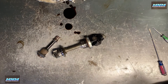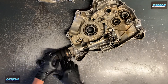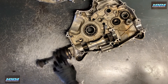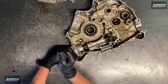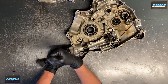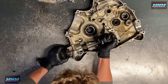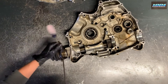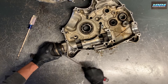We have what looks like a similar situation here on the front. We've got our boot and all this joint assembly here. I'm going to try to remove the boot right up against the motor here. You can use a flat or Phillips screwdriver or an 8 millimeter socket to remove or loosen this clamp. What we need to do is get to these Allen bolts here — that's what's holding this shaft in. These boots are very, very thick and very stiff, so try not to rip it. There's a lip on this cup that makes them a little difficult to get off.